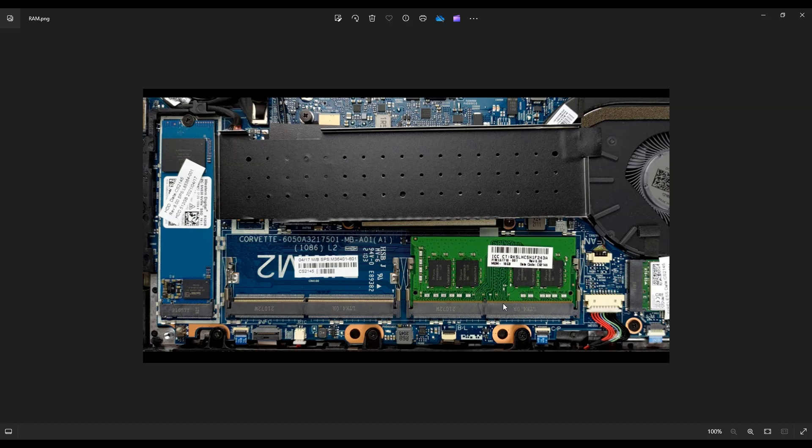To get the RAM back in, there's a long side and a short side to the RAM stick, so there's only one correct way to plug it in. You get that in there nice and flush, then press down in the center — those metal arms will snap onto it and hold it in place. The solid state drive is held on by a single screw up top in the middle; undo that screw and you can pull it out of the port. I think in this computer the maximum RAM is 64 gigabytes, which is a good amount. I'll have the RAM specs and replacement and upgrade RAM and solid state drive suggestions in the link below.